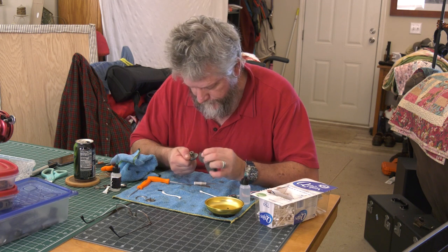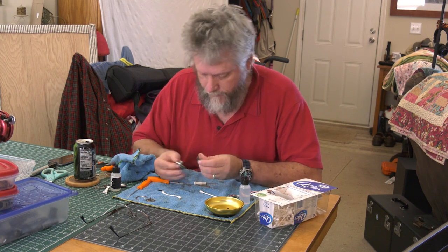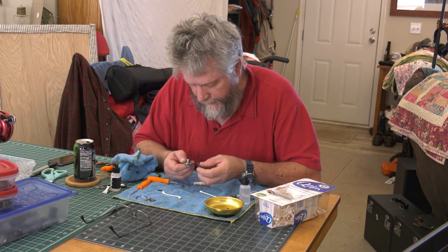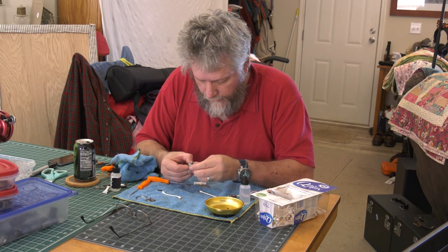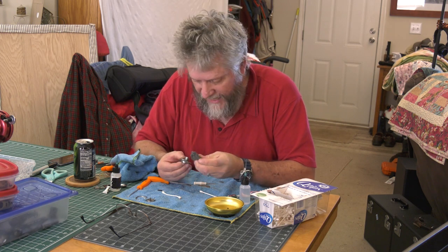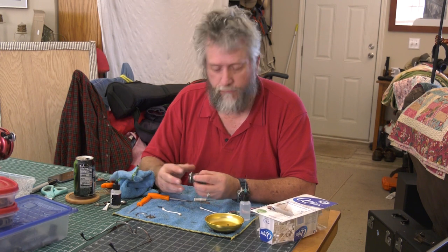One thing I might mention to you too, on the chroming process, I actually had to deal with that too. Because on headlights and taillights, when you're making the buckets, they have to be chromed. So I can't say about chroming metal, because I've only done chroming plastic. And it's a real interesting process, because you put your parts on a rack, and the rack goes in this big cylinder, is the best way I can describe it. And inside that cylinder, they've got bars of aluminum. And the process is, it would pull such a strong vacuum, you know, that there would be no atmosphere. And I forgot how many atmospheres it pulled minus, but put it this way, you'd be gone just like that. It would rip you apart.